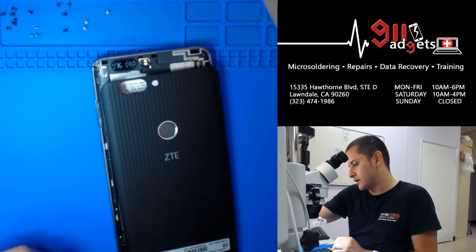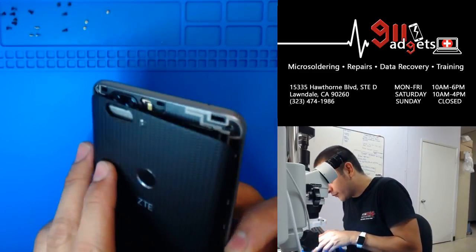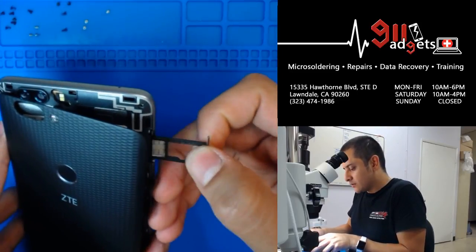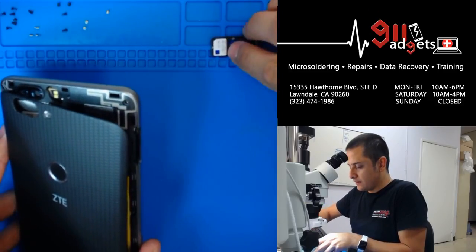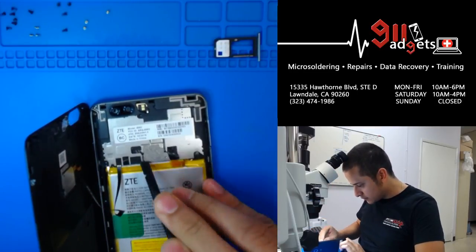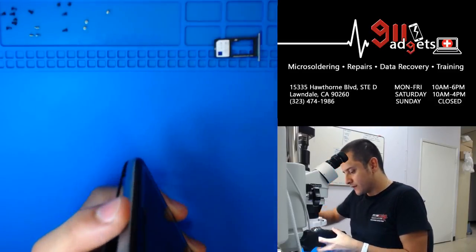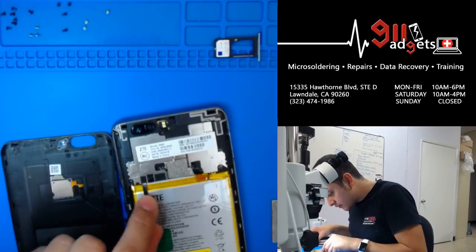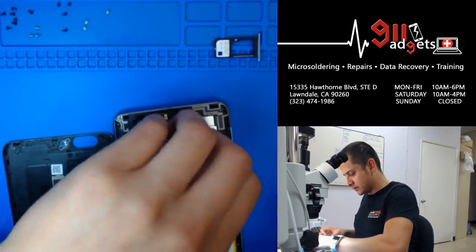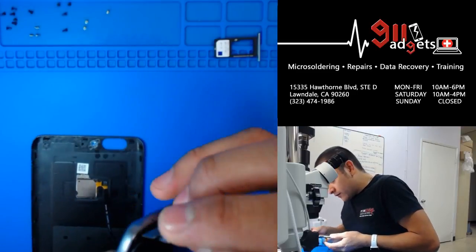Like with the Samsungs and other devices, don't forget to remove the SIM tray. You just never know if it's holding the board or the frame together. I don't remember if this one has it or not, so I'm just gonna remove the SIM tray. And then I'm gonna see about, let me see here. If I'm not mistaken, the screen comes out first. I want to see if I could get rid of this home button, because it's really in the way. I don't want to rip it. I guess I'm gonna have to just wing it and do it without removing that.